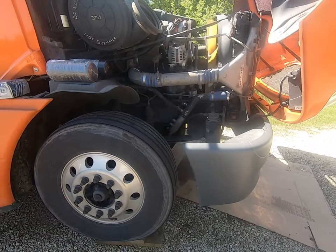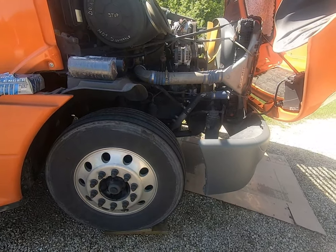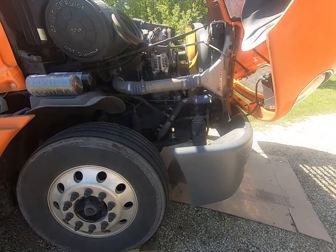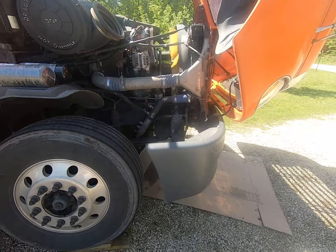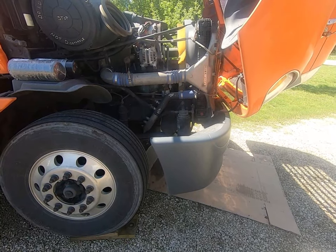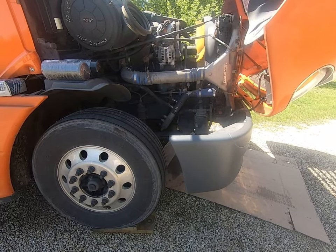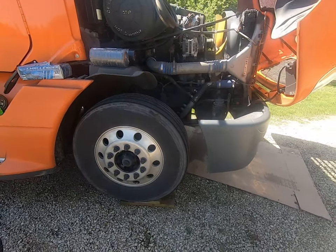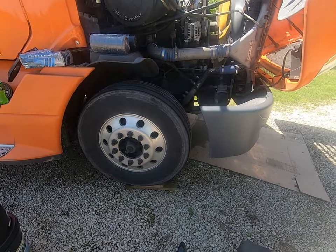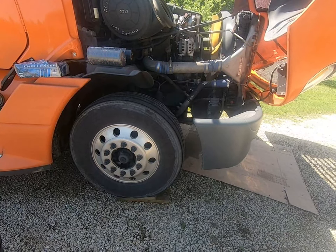Some advantages of doing it yourself — some disadvantages would be you're gonna make a little bit of a mess and it's probably gonna take you a little while, but that's alright. The advantage is we can do a better job. We can get a good long drain on that oil. You've probably noticed when you go to the quick lubes they don't let the oil drain all that long — there's still oil coming out when they put the plug back in. We're just gonna get a good long drain, get all that dirty sooty oil out of there, and we're definitely gonna recycle the used fluids. You'll need a couple empty buckets. The capacity for this system is about 11 gallons because I have a bypass oil filter on here that takes a little over a gallon.